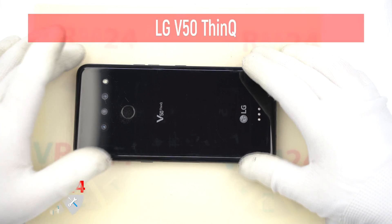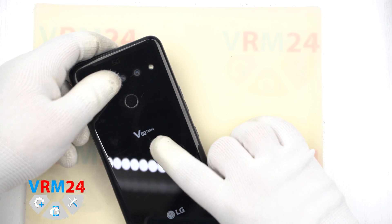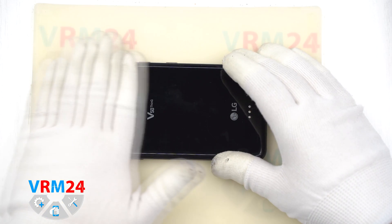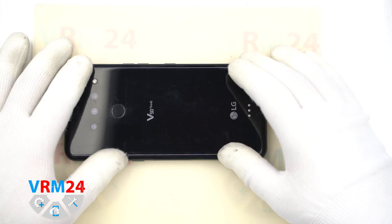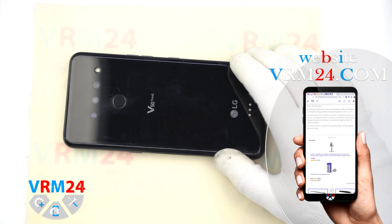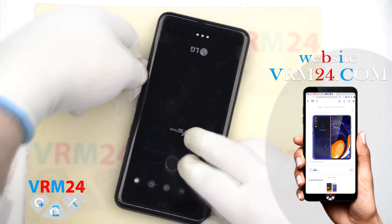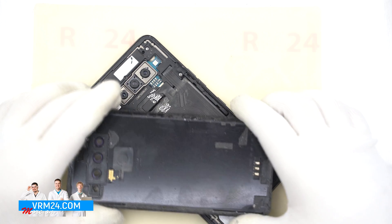Okay, now we should open — in our case barely glued — the back cover. As always, we should heat the back cover with a heat gun or heating mat up to 70°C (158°F), and after that start to open the back cover. We use a plastic film or sheet and move it along the edges, starting from the far corner away from the cameras, moving carefully. In your case it will take much more time.